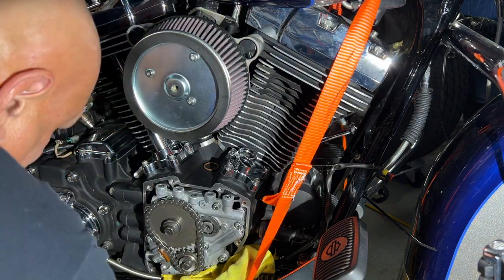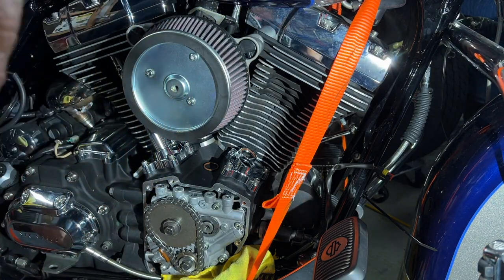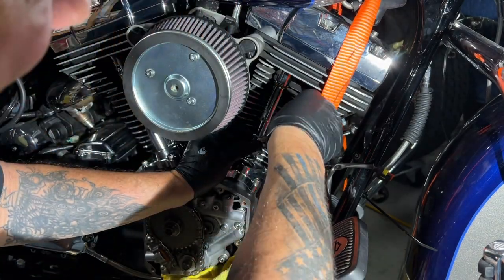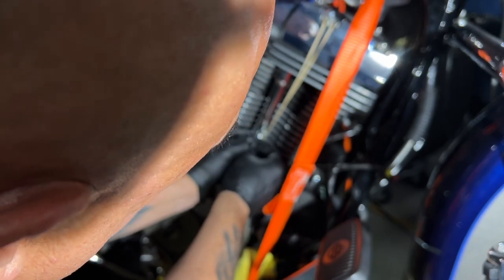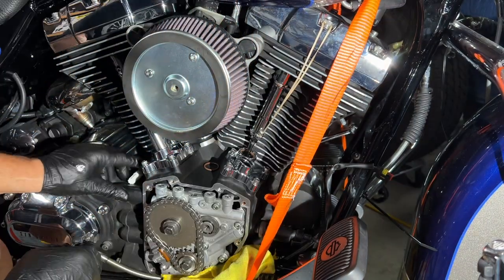I'm putting this o-ring back in there, making sure it's in. I'm getting this tube for the intake, making sure it's in there, then I'll hook it and bring it up to hold it. Then I'll bring this down and start turning to get to zero lash. I'm holding the top and turning the bottom one — sliding up and down a little bit. Hear it ticking? There it is — it stopped. It's at zero lash right there. Mark it right where it's at.